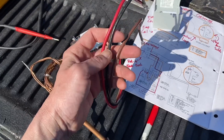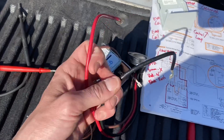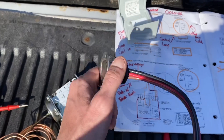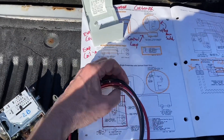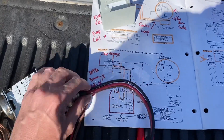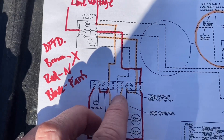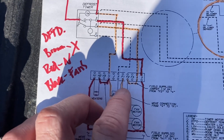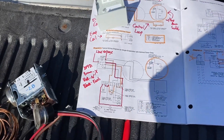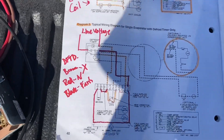To diagnose these you can ohm them out — I've found plenty bad ones over the years. You can ohm between red and black, and if you're really cold in there, frozen up, and this is open between red and black, chances are this control is bad. If you didn't have one on you and needed to get by in a pinch, you could try wire-nutting red and black together — but if it's open it won't work. What I would usually do is eliminate it: take a jumper wire from N to F. Your fans won't delay after a defrost, but it can get you out of a jam in an emergency situation.